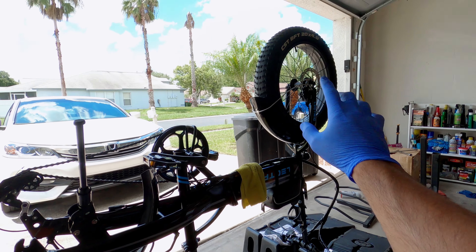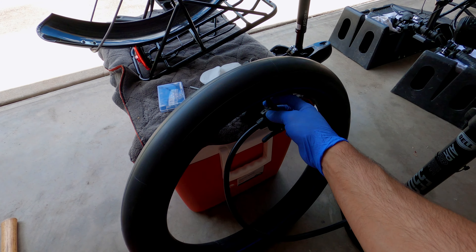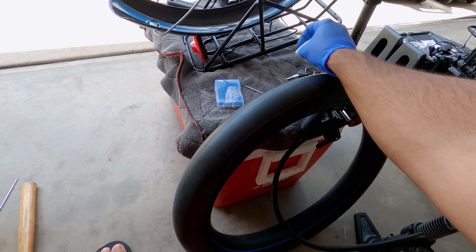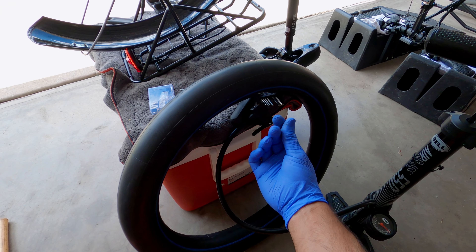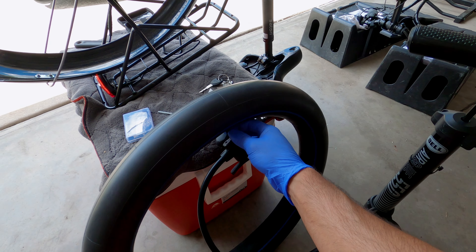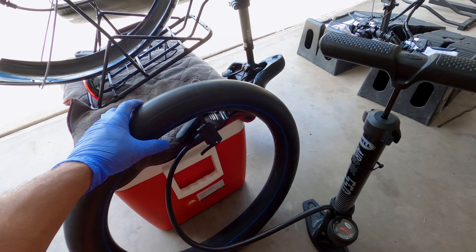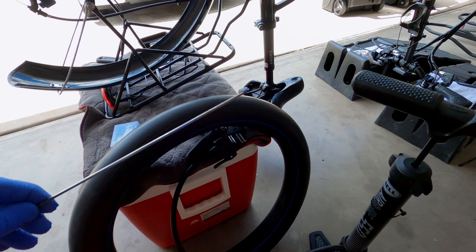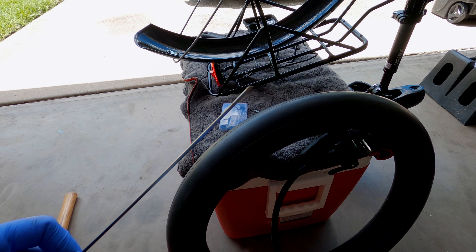I was able to get the front wheel done with no issue. But then I started researching on how to fix the clogged tube. According to the slime website, they want you to use a cotton swab with water to see if that'll work — and that didn't work. I read a couple of forums with some other ways. I really didn't want to use one of my extra tubes, so I wanted to see if I could save this one. What I ended up doing was grabbing a metal skewer and heating the tip up on the stove.